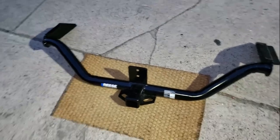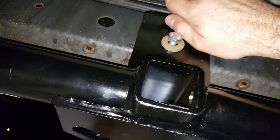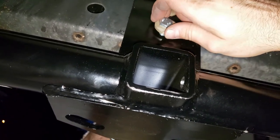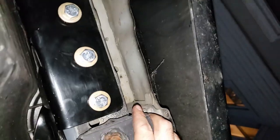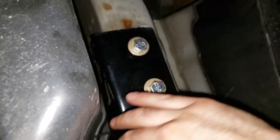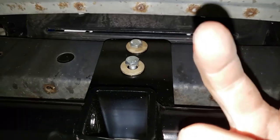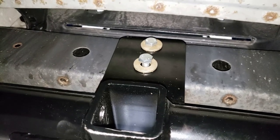I did a dry fitting, but either the hitch itself is slightly off or the frame of my truck is slightly off, so I'm going to try to bend this back a little to get it to slide into place. I'm putting all the bolts in just hand tight — these washers have teeth so when you tighten them all the way down they won't back off. As I was putting it on, I found that either the truck frame or the hitch was slightly bent, so I had to take it off, whack it with a sledgehammer a few times — whack the side arms outward, whack the panel right behind the bumper inward — to give myself more flexibility. Took it off, whacked it a few times, put it back on.